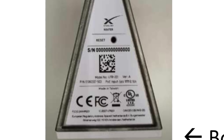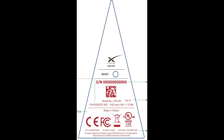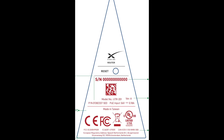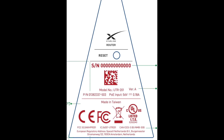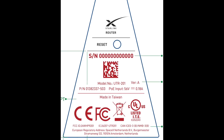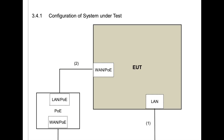Here's a photo of the bottom of the device, and we've also got a detailed diagram of what exactly is going to be on the label — you can see the name there, Starlink router. It also appears to be powered by Power Over Ethernet, just like we think the dish will be as well. And this diagram shows the test setup they used at the FCC, which shows it's going to have at least two Ethernet ports: the WAN carrying the power and signal from the Starlink dish, and then the LAN available for internal wired devices.